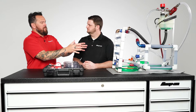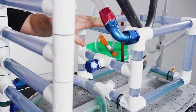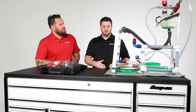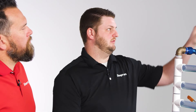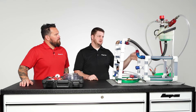We've talked about the system and now we have a demonstration over here. This is just a very rudimentary model of what a cooling system on a vehicle is — you've got an engine block, radiator, upper and lower hoses, thermostat sensors and whatnot. The demo will show you how to quickly refill your system while pulling vacuum with this tool. I'll get up on the ladder so I can see that we've reached maximum vacuum. Once we do that, we'll close the system off and then pull vacuum through the coolant and fill it up.